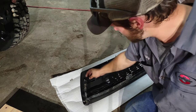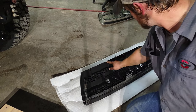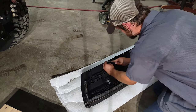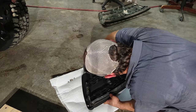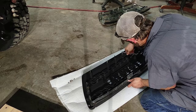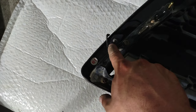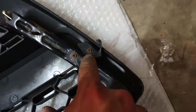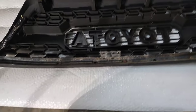Make sure before you put this bracket on, you remove the nut on this stud here and on the other side. And before you mount this grille up, you have to remove these nuts as well — these here are going to be 8mm. Take in mind that these only go in one way, so you'll find the little slot that the prong goes into. Make sure you've got all your screws tightened up and your nuts off of these studs, then go ahead and mount it up on the hood.